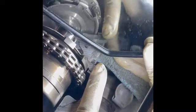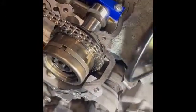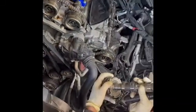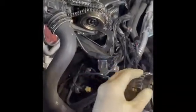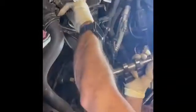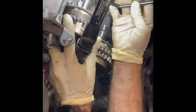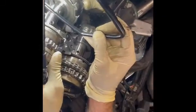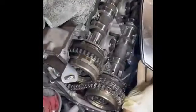I'm going to put the camshaft in so you can see it better. If I put this camshaft in the base position, this is the marking I'm looking for — I would put this marking and it should be aligned with the outside edge of the camshaft. Look at that — it's aligned with the camshaft and the camshaft is in a rest position, resting on the cylinder head.